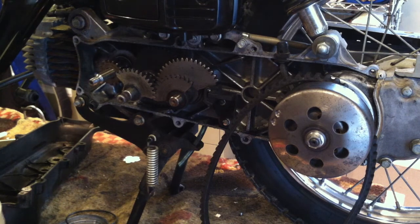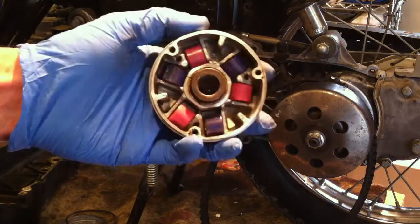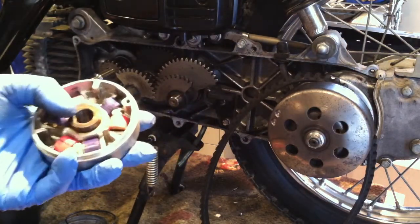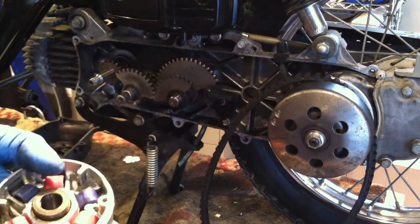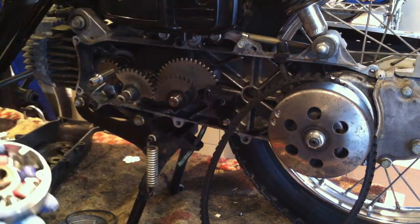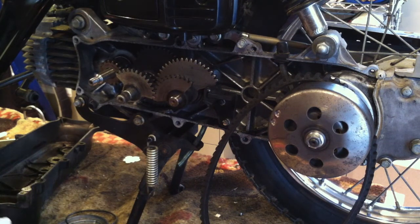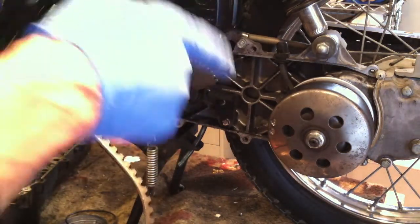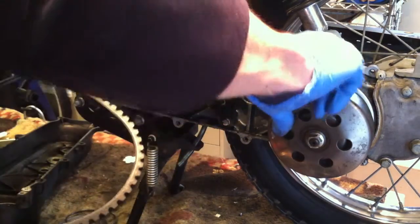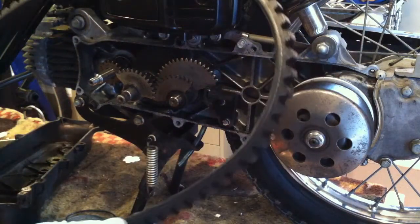I have 27 plus 9 grams — 36 grams in the variator. I just put on a new GY6 scooter clutch with the yellow Contra spring and the yellow 1500 RPM springs. I did my little trick with the stock belt. The problem is with that yellow Contra spring, the cheeks of this pulley are pretty hard to pull back, so in pulling the belt off I've created a bit of a problem.